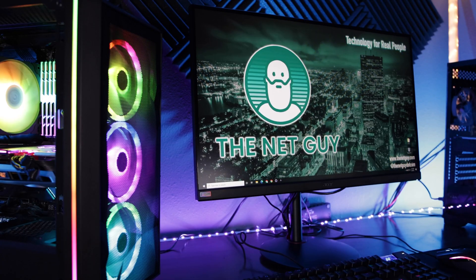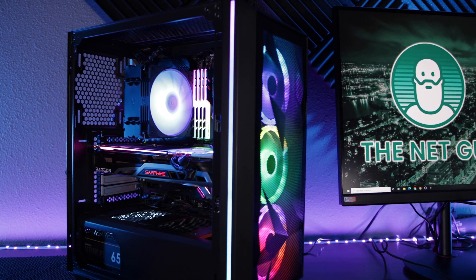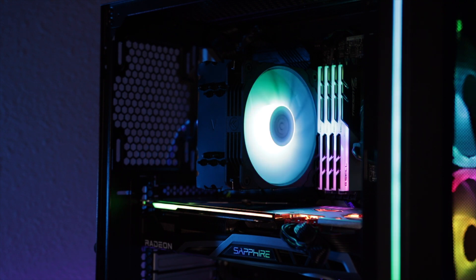And lastly, looks. Nothing is quite as boring as a factory AMD cooler. With plenty of RGB and that large fan with translucent fan blades, it just looks cool. I also like the fact that it has a true digital addressable RGB header and not a simple LED strip interface. This means you won't need a controller to run it, and they've included an interesting splitter so you don't lose addressability for other devices.